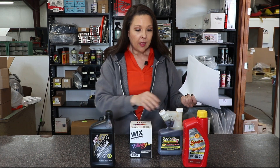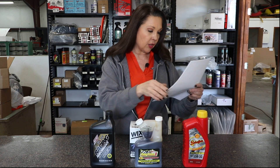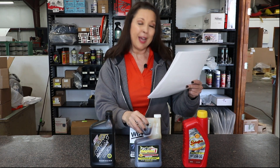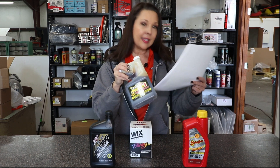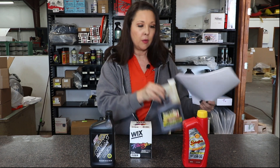If you're using any other oils outside of these, they also strongly recommend using the Daytona 1 XL1 engine treatment. In their own house car, they gained 8 horsepower and 12 foot-pounds of torque by simply pouring this additive into their engine. You don't need this if you've got the Klotz, but if you're using any other oil you want to use it — and make sure your engine is broken in and your rings are seated before adding it.